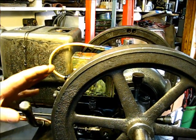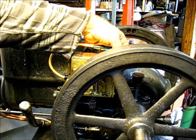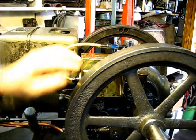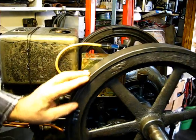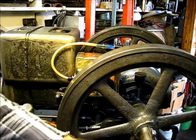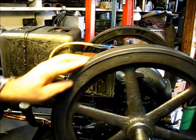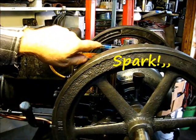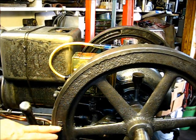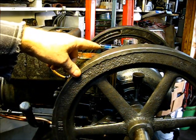You have to have the spark plug in the engine to confirm that you're on the compression stroke. And maybe we can see that — the blue part is what we're watching. And you turn this around there till you come up on the ignition. Did you see that spark? Now, we were way off. The ignition mark is way up here — we were way off on the timing. But it did produce a spark the first time.